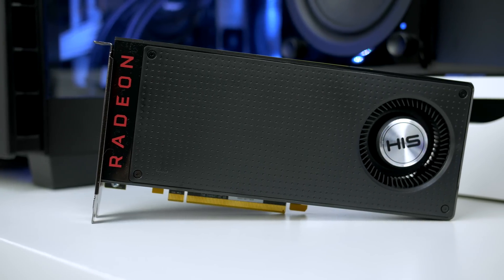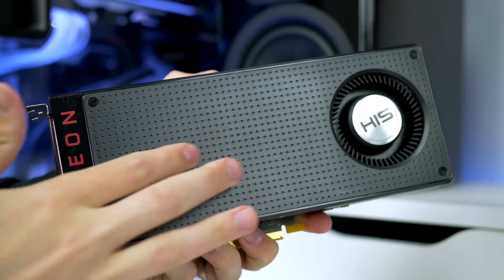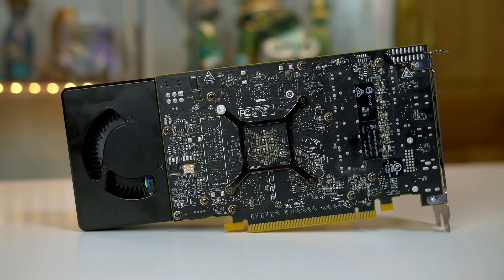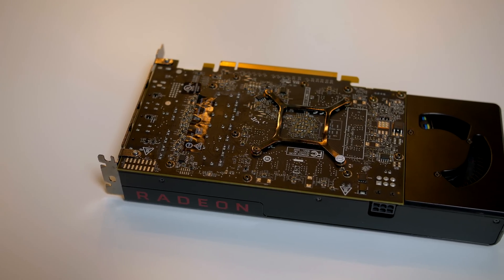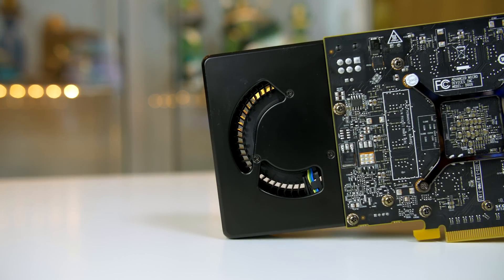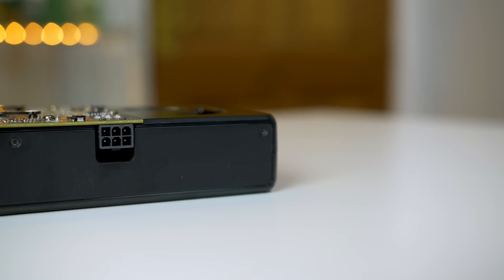Let's take a look at the design of the card itself. There's no RGB or sharp features — we basically have a black rectangle design with textured plastic on the front and two red Radeon logos. The PCB on the rear doesn't feature a backplate, but XFX have released a reference design with one. The card is pretty short at 9.5 inches or 241 millimeters, and the 75mm blower-style fan features a metal housing and is open on both sides.